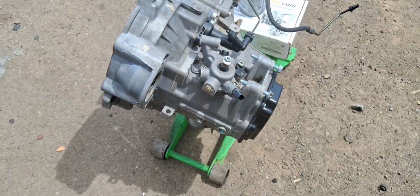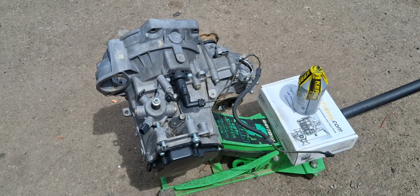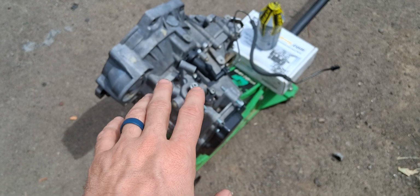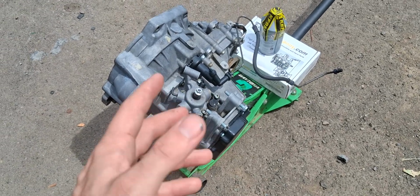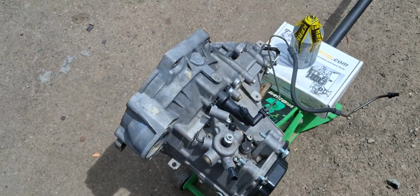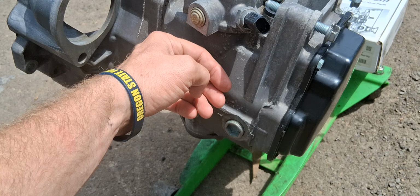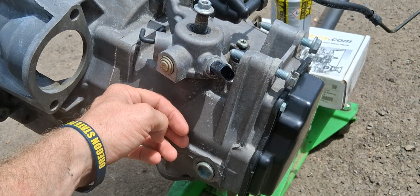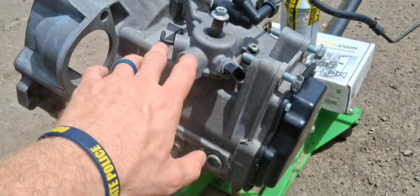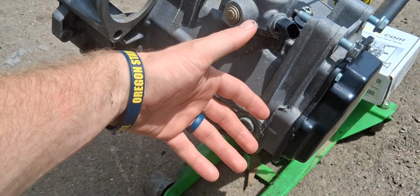It's very simple, but go the extra mile, guys. Make sure your fluid is in the transmission and it's present. Don't buy the lifelong oil scam. I'm not saying it's a scam, but you're not taking into account cars sitting through a winter. When vehicles sit through a winter, they attract moisture, especially in an aluminum housing like this. Any type of alloy housing collects moisture inside. Now imagine letting this car sit for a year or two. Even if it's under cover outside, you will still have moisture that gets in here, and that means it's mixing with your oil.